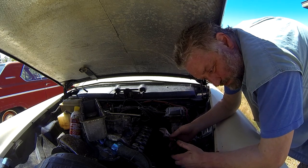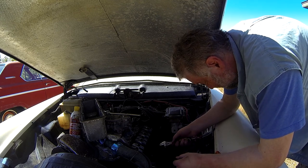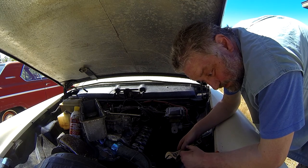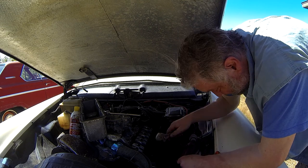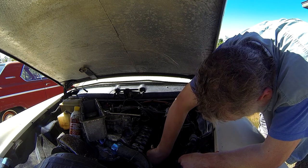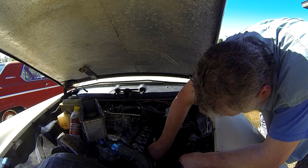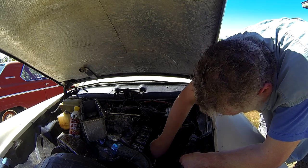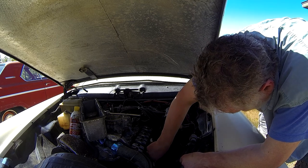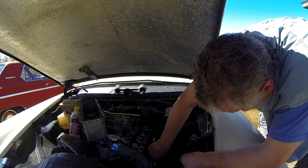All the stuff I'm doing is just in preparation for doing all of them. I just wanted to get down to the brass tacks of this whole scenario because this is what we have to do in order to make it start without the manifold. I'm not starting it again without the manifold on is what I'm saying. It was sketchy last time. I knew what I was getting into, but hence the fire. Plus, I poured a lot of gas down the carburetor, so some of that was allowed to vaporize, and then it came out when I was trying to start it, and then any kind of spark was going to set that off.